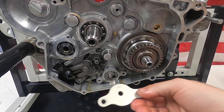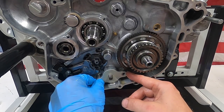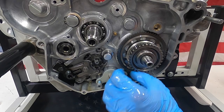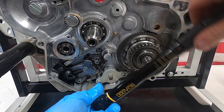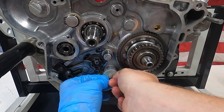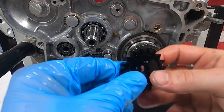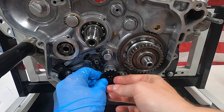Make sure it's lubricated. Next is going to be the oil pump cover — there is an indication on here that says 'top', so that's going to go on there. It is going to get blue Loctite at 7.4 foot-pounds. Next will be the pin, followed up by the oil pump gear. I don't like how they're plastic, but this is the oil pump gear itself — that's going to go on next, followed by a washer and a snap ring. I have heard of these things wearing out, and then it causes a loss of oil pressure, and then bad things happen.